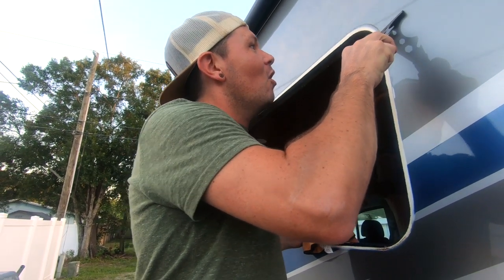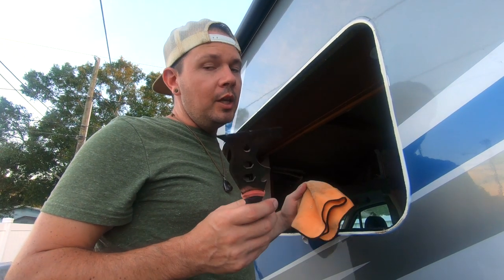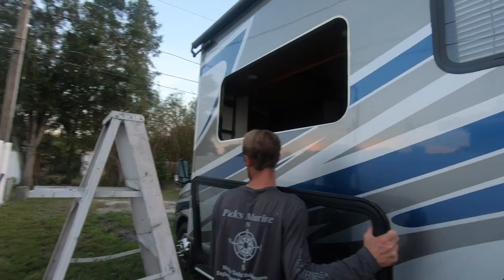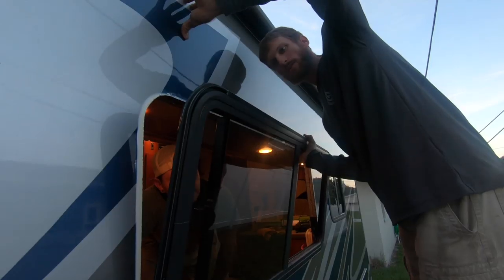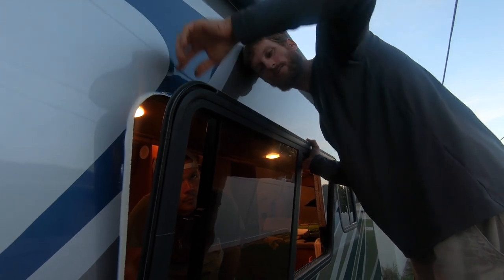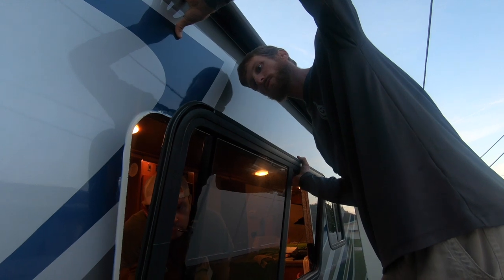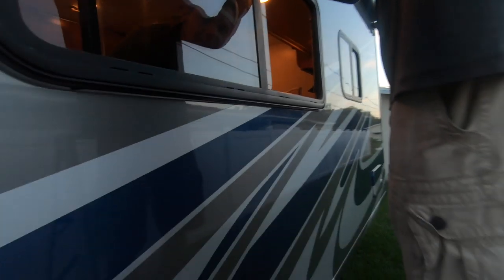We're almost done. Once I get the rest of this cleaned up, I'll show you what we're going to use to seal the window frame — it is a butyl product but it's not butyl tape. We scored the inside of the window frame so we could see where our contact point was going to be, and it looks much better than before. Now we're going to go ahead and put the seal on, knowing it'll be making contact with the RV itself. Time to install — we're losing light.